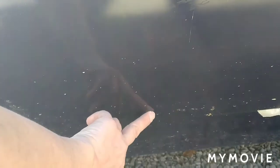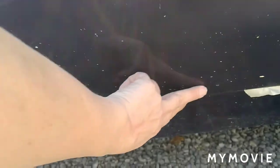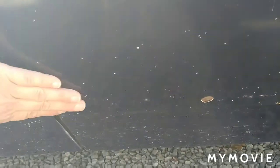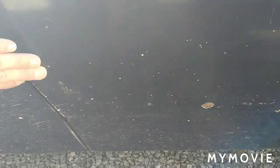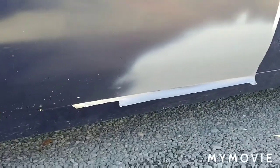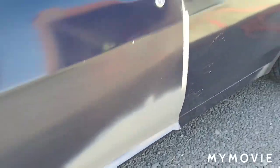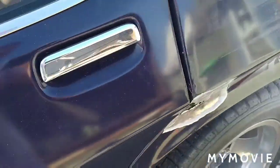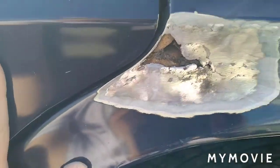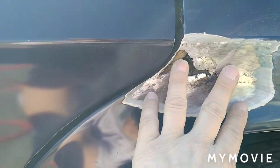So what do I do now? I want to fill it up with bog, but that whole bottom of the panel is rust poking out and it comes up here. So essentially I would have this massive repair for the whole door. I simply don't have the time or equipment. And up here, there was a chunk of bog coming off, so I've dug into that to repair it, and there's no metal left.